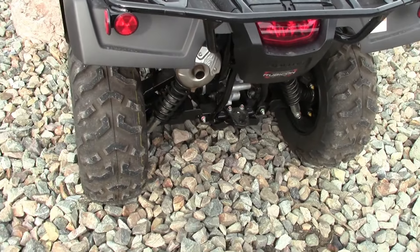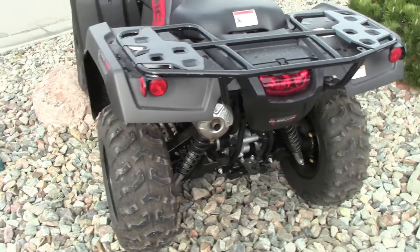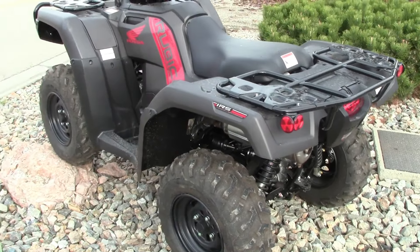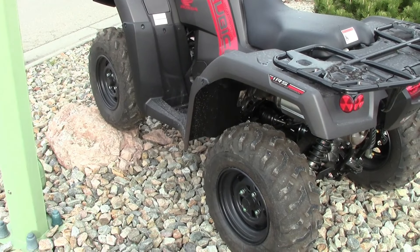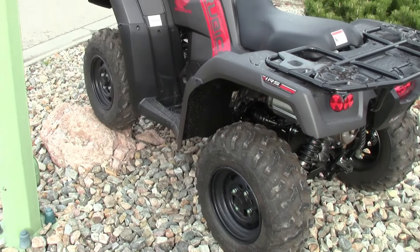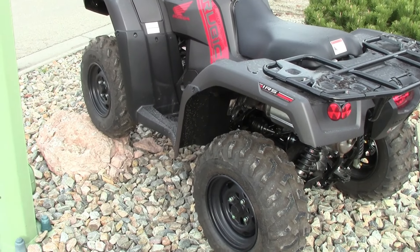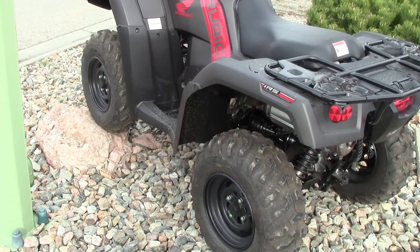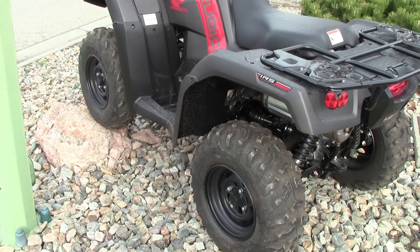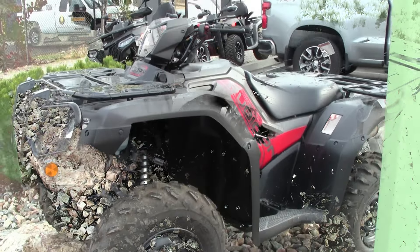As you've probably heard me say, the Honda has actual gear speeds — it's more of a car transmission than a typical powersport CVT belt drive. It will act a bit like a car when you're gearing down, with a slight jerk between gears. It's not as smooth as a typical ATV belt drive, but some guys really prefer it because there are no belts to worry about. Honda's transmission has been flawless and the overall machine is built incredibly well.